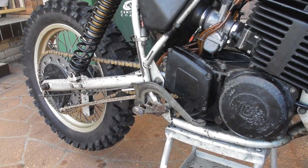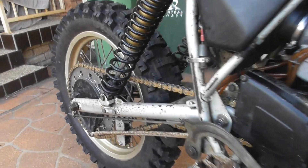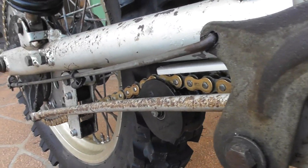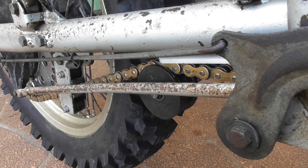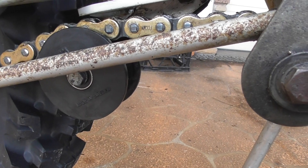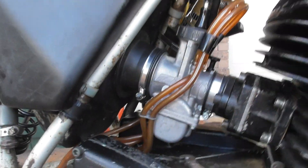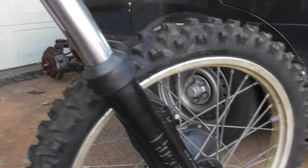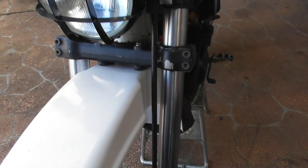I've done an O-ring chain conversion on it — it basically didn't have O-rings originally. What happened is these rollers in here — I had to remake the rollers wider to accommodate the O-ring chain. Believe it or not, that is the original chain roller off the bike. This bike has been sitting around for a long time and not ridden, as you can see from the oxidization.